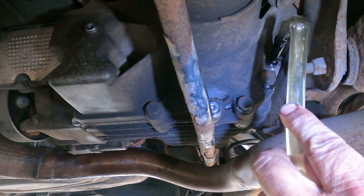Same as the rear: top off first and then drain. Let's whip those off. Space is limited when you're removing the fill plug from the front, so once you've got the tools in there you can't really see what you're doing — you'll have to do it pretty much by feel. But it's pretty straightforward and not really that tight, so it's pretty easy to get the plug out.